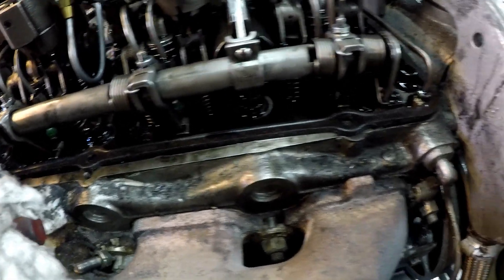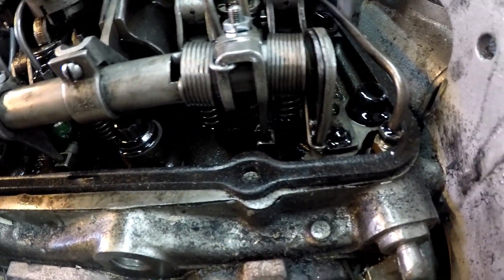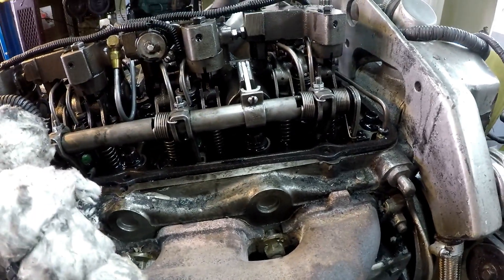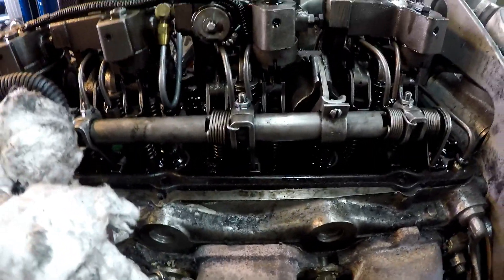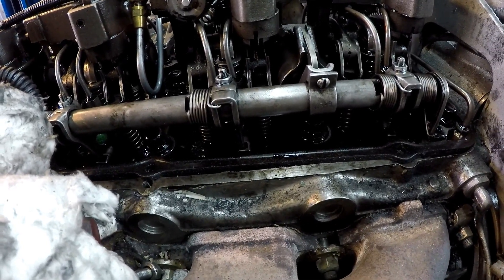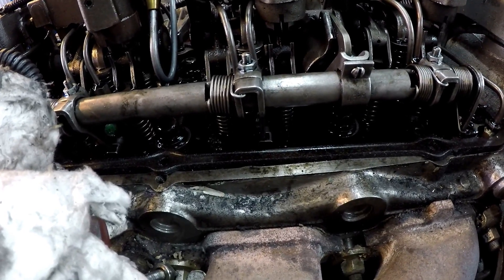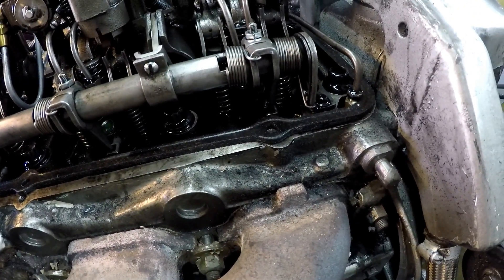You'll see that the rack is set at about a quarter throttle — that's what full fuel demanded. As soon as you add boost, it allows the rack to go to full fuel. You see the fingers on the injector — I was talking about letting them roll up. See them roll up? The little ears on the end will roll up, and then you know you've got your rack set nicely.